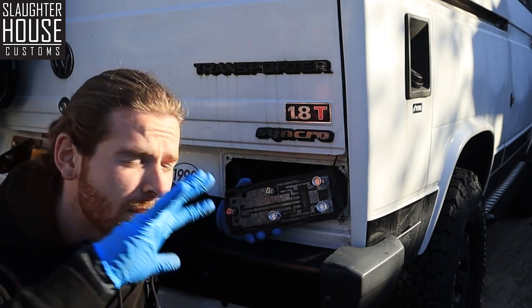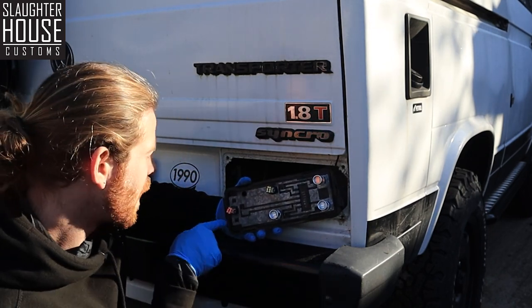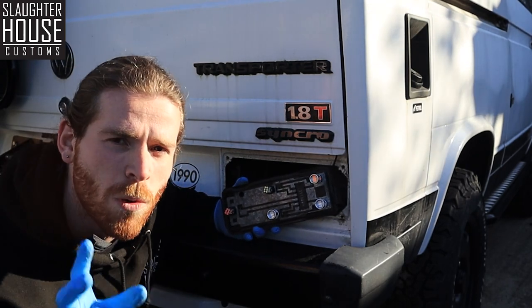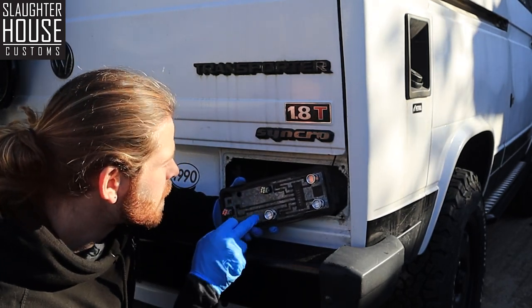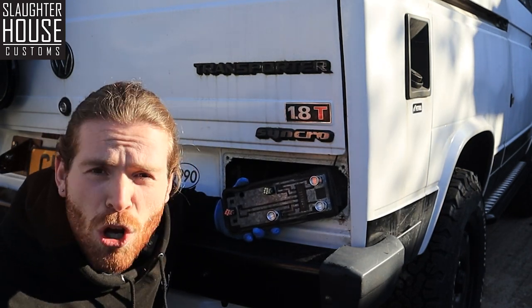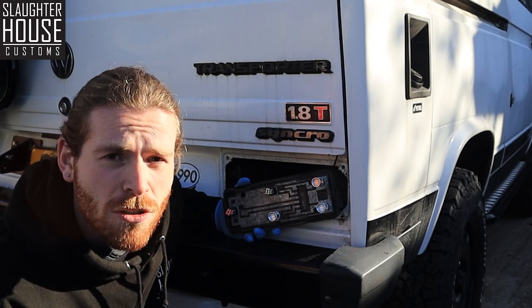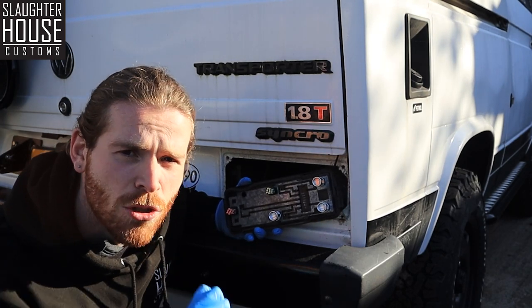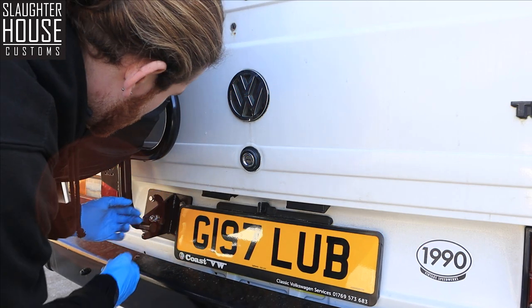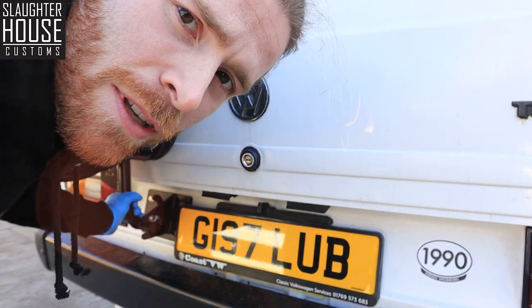On your right-hand rear lights, you will place your fog light in the far left socket. It's important to be aware as well - if any of these connections and sockets are gnarly, if they've got a lot of corrosion or rust on them, take a bit of Scotch-Brite, whack it in there, give it a good swizzle. Hopefully you'll get a good connection from that. This van has a very nice SHC wheel carrier on it as well - it's on the website, link in the description.